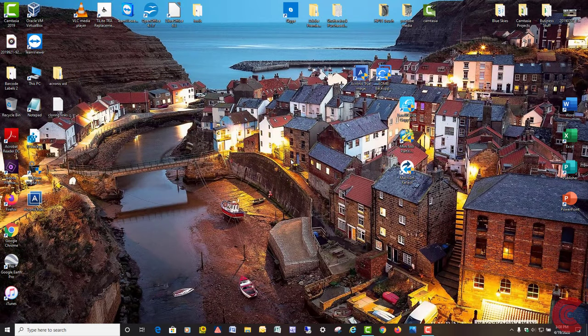Looks perfect. Just follow the steps I outlined here so you can have a good clone. Run the check disk or the scan for errors through the properties on your C drive, and you should have a good clone.